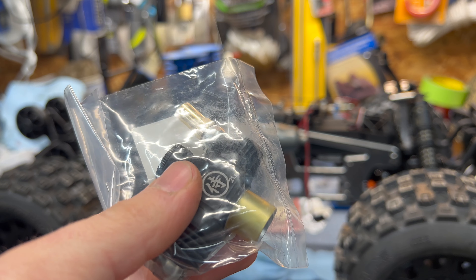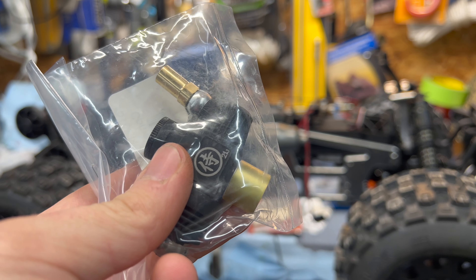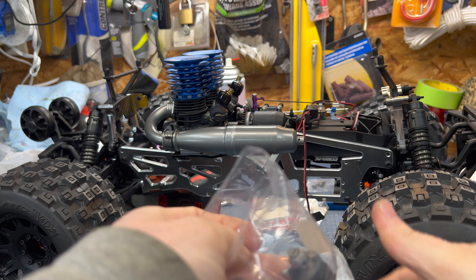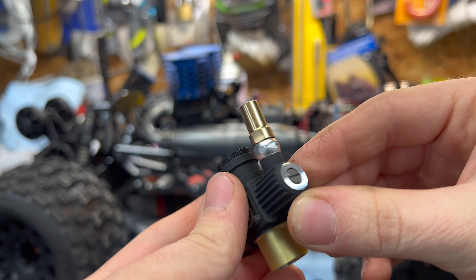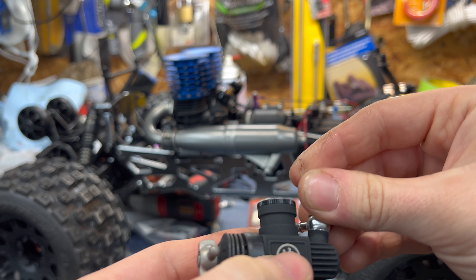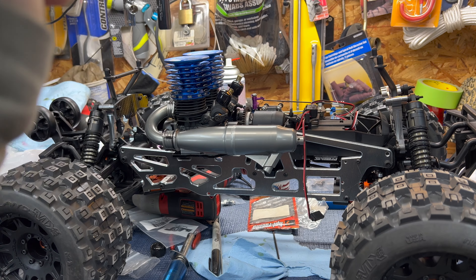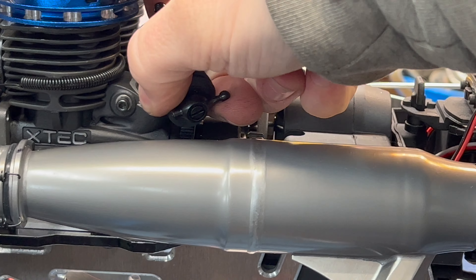The shoes are installed. I'm not going to lie, I almost lost my patience, but then I remembered I do have a clutch tool from M2C and it just made putting those shoes in a breeze. All you do is get your spring and shoe lined up, give a little twist and push down at the same time, and the shoe locks right in. If no one buys your clutches, M2C, you should just keep selling these tools or offer the tools by themselves — that's a nifty tool. Now we get to fiddle with the shimming.